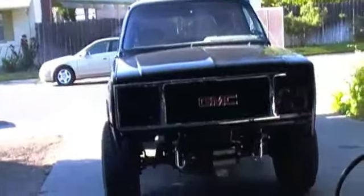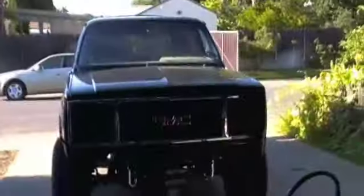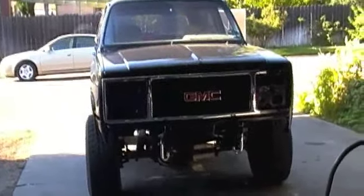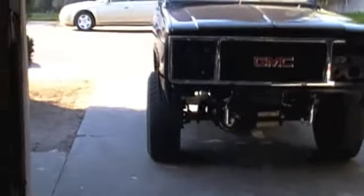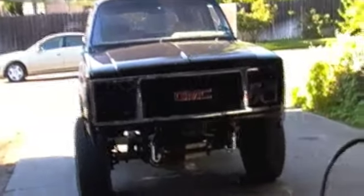What I'm going to do with the truck is put it all back together and probably drive it for about six weeks or so to let the paint get nice and cured up. And then I will be doing a final wet sand and buffing it out. Nice thing about this truck is the trim that would normally be in the way will come off real easy, so when I buff it I can take the trim off and just do it.